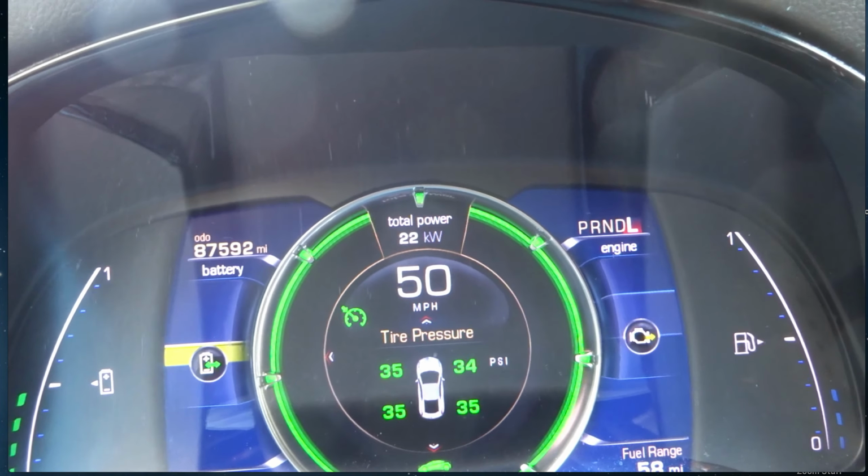And at the end of this video, you will see the regenerative braking kick into, I think it was the high negative 20s area. And that is when I actually just tapped my foot on the brake for a second, only to stop the cruise control. Because once you touch the brake on a vehicle, the computer in the car realizes that I no longer want my cruise control to be on. So it just kicks in regenerative braking to full tilt.